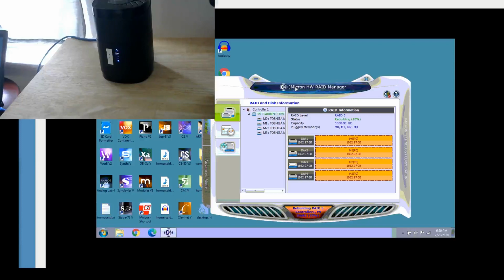I downloaded this from some shady site on the internet, as I mentioned. I plugged the device in, and I saw that it was rebuilding. It was rebuilding because right before I made this video, I decided to see what would happen if I unplugged the drive, turned the unit on, turned it off again, and put this in, and then turned it back on again. Even though nothing's changed, there's no way anything could have written to it, because the device had not been mounted under Linux. It was completely read-only. It still started to rebuild that disk.